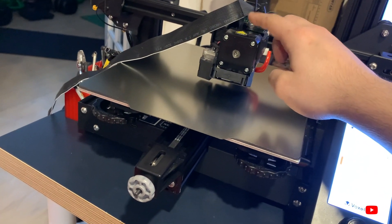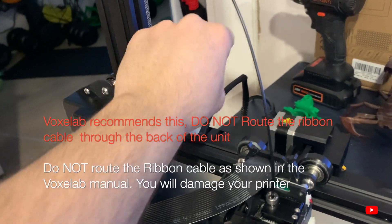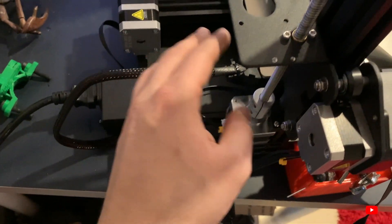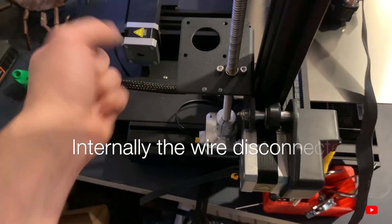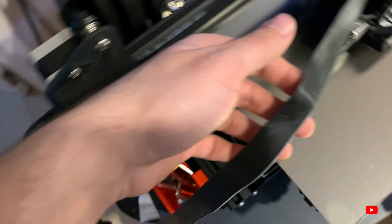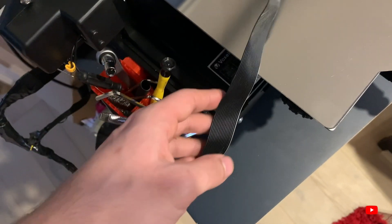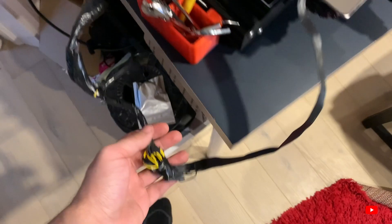First and foremost, the ribbon cable. As directed, it's recommended you route it through the back portion of the printer and zip tie it. Typically it exits through the back in line with the power cable. The problem is that after two or three months of printing, it can tug and sever the connection. This is not just my problem — the Ender 3 V2 and the S2 have this issue too. As soon as you get it out of the box, remove that connection and route the cable through the side instead.